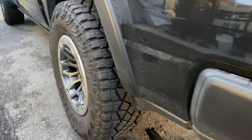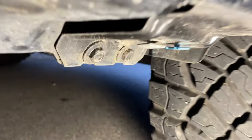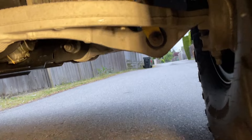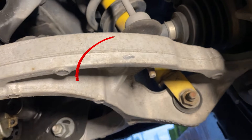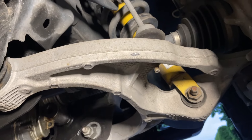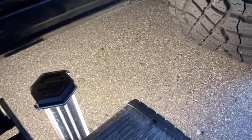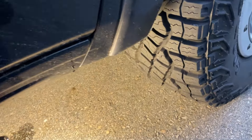That metal tab will lift up your rear-sided tires — same for both rears. For the front right and front left, it's going to be right here on the control arm — the tab circled right here. Put your scissor jack on that control arm and the middle rod will stick out; as you turn, the vehicle will raise up.